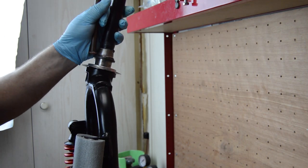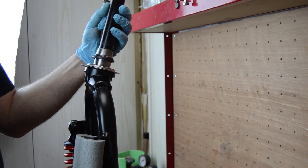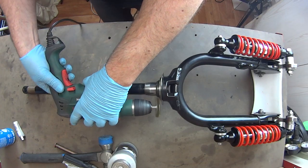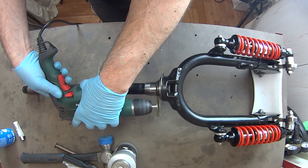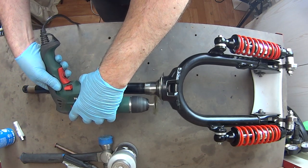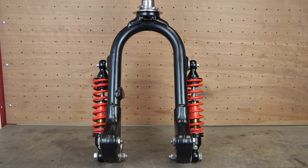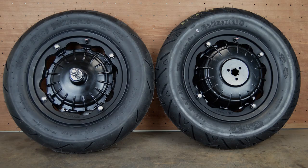The final bit of the fork build is getting the lower bearing race onto the fork crown. This turned into a very slow and tedious process, so I've spared you the monotonous ordeal and gone straight to cleaning off the brass left on the race with my drift. And well, there we have it - one pair of snazzy forks and a pair of very black wheels. Nice. It looks like I have the beginning of the scooter at last - well, the front half of it anyway. I'll see you later.